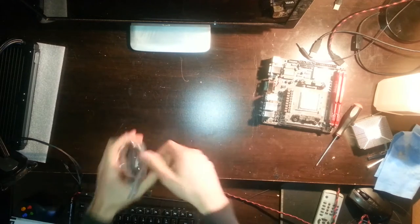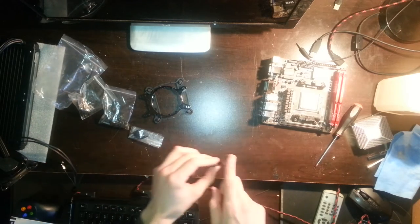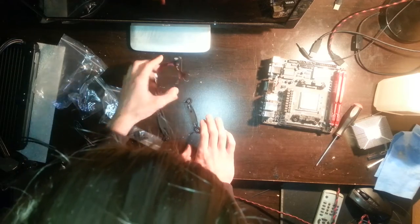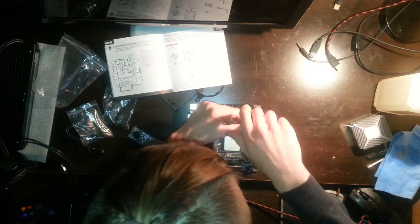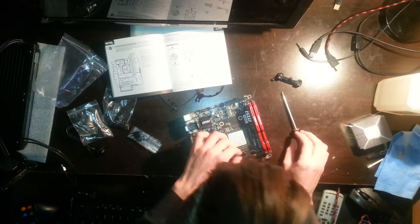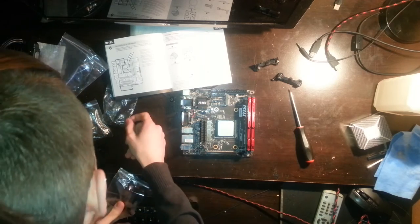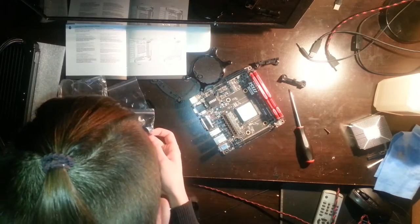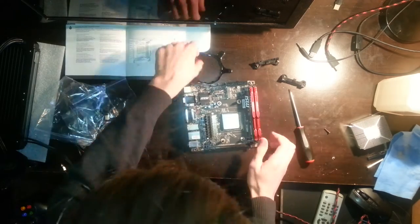I don't know why I tried to remove the big backplate — you don't have to. The black one you see there is the AMD one; the chrome one on top is for Intel CPUs. This USB connector connects to the pump so you can see temperatures and stuff. Always use the handbook — it's easier. First, unscrew the holders for the old CPU cooler, then use the AMD standoffs to screw into the backplate. I had to compare them to figure out which ones were the AMD ones.